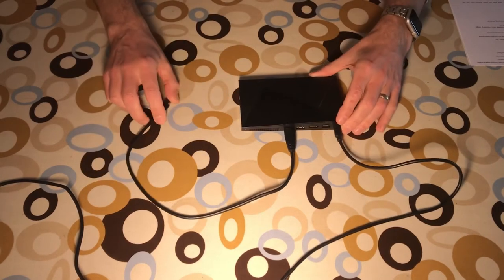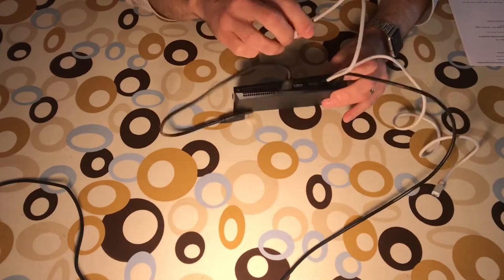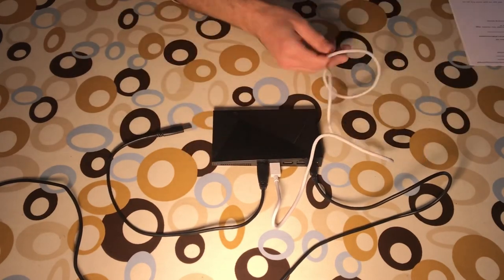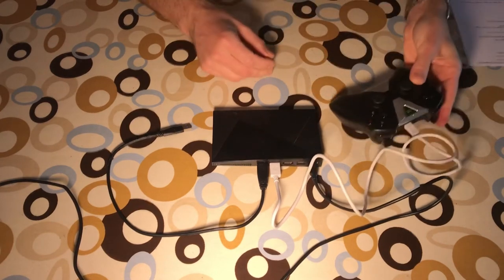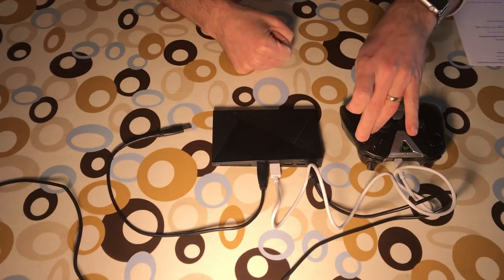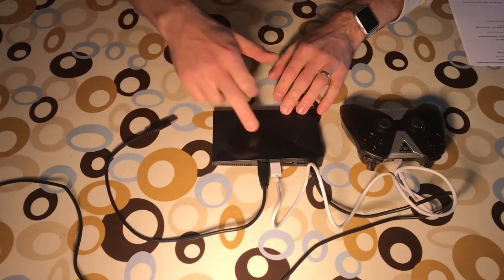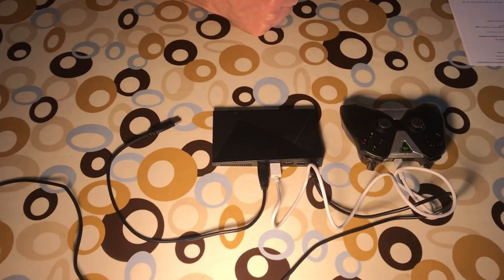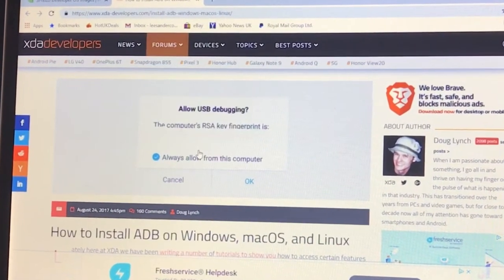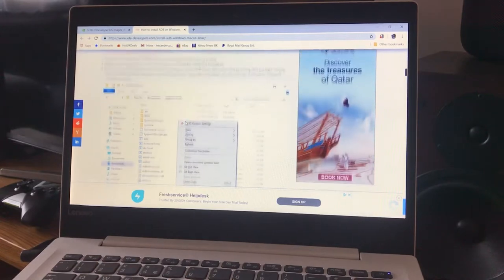If you're not able to run the Android OS on your Shield but the fastboot loader is still intact, you can plug in a micro USB cable and use the fastboot method — pressing and holding A and B together while the other end is connected to a computer with HDMI into a monitor. The first link is on the XDA Developers site. I'll put a link in the description. The instructions there are really good, and all the download links were working. It covers Windows, Mac, or Linux.